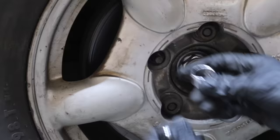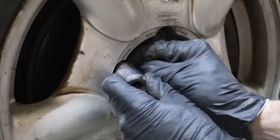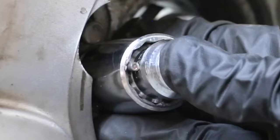The sleeve will prevent the socket from working on the Dorman, so assuming we've already spent two minutes removing the sleeve, I couldn't find a socket that was just the right size. So I tried using a couple of nails and a slightly oversized socket, wedging the nails between the socket and the wheel lock. It took about five minutes total to remove the Dorman wheel lock.